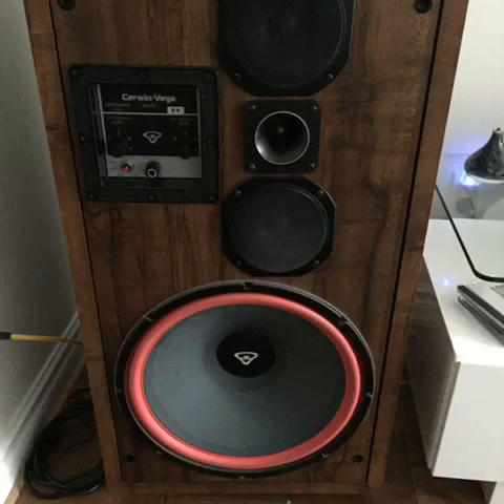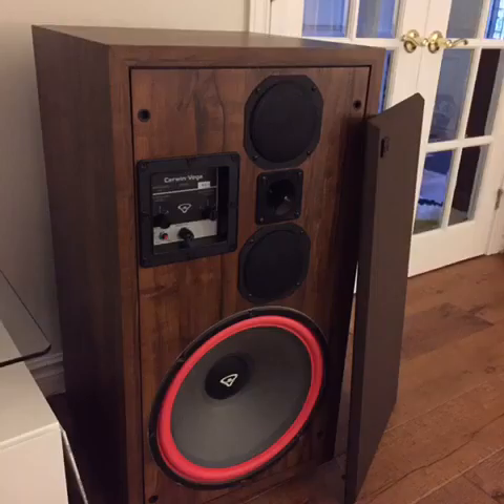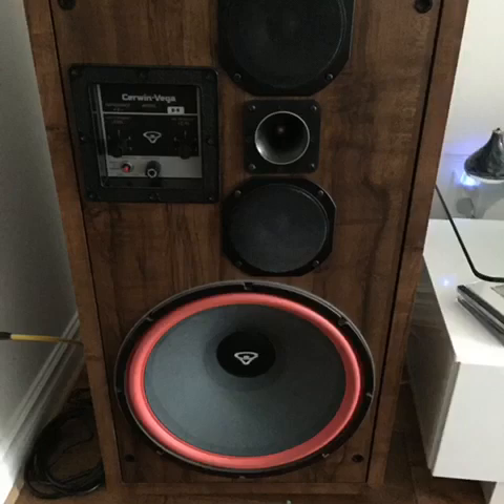Here's the first pair of D9s I had. I'm going to flip over to the pair we just sold — tell me what you see different. You got it: that bright red foam surround. This is one of the reasons why Cerwin-Vegas get a bad rap, because the foam basically disintegrates, kind of like a Fiero if you remember that car from the 80s. But depending on the atmosphere — whether they were in direct sunlight or a damp environment — they can, like this pair here, last about 30 years.